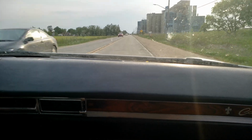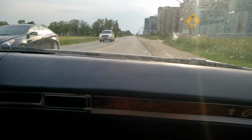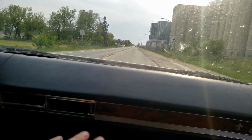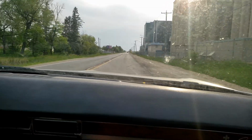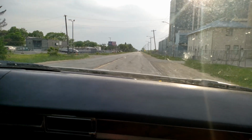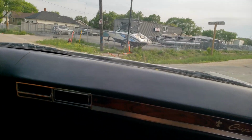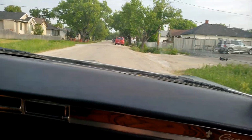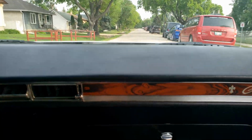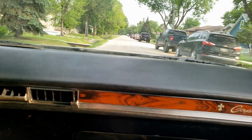And you already changed carburetors, right? So you changed carbs, fuel pump, and you did intake gasket or just carb gaskets underneath? I did the intake gasket recently, but I already rebuilt the carb. Oh, okay. I think maybe possibly Teflon tape on the carb. Another thought, because these bodies are really bad for stripping out on the fuel filter. Yeah, these early Quadrajets, and they only have two Quadrajet bodies.